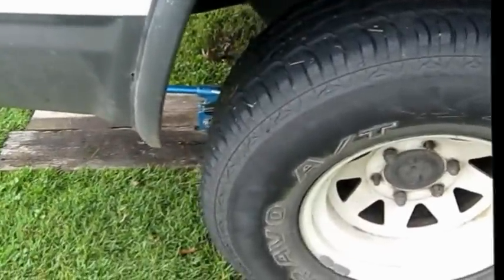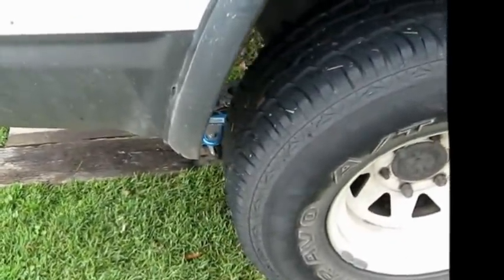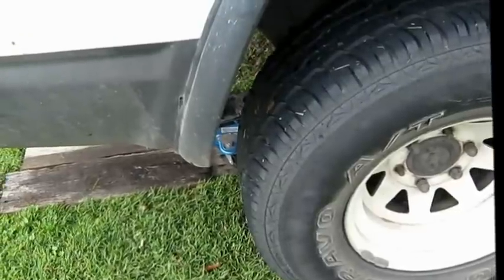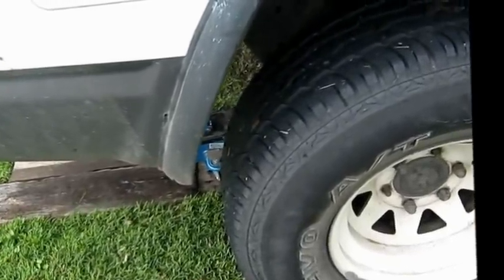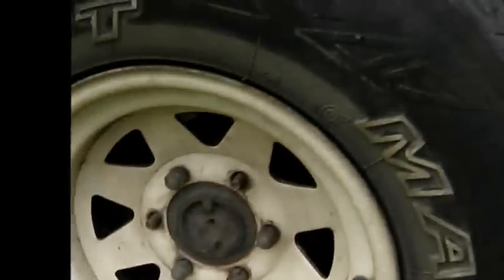My back brake caliper is leaking oil, and we're just going to put a new kit through it instead of buying one. So we're just taking the back wheel off, and that's the kit there. It's just a couple of rubbers and washers. Yeah, they're ready to go. Just take the back wheel off and then we'll show you what else is there.